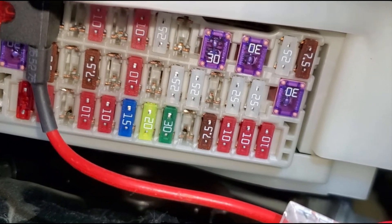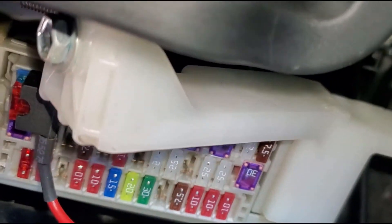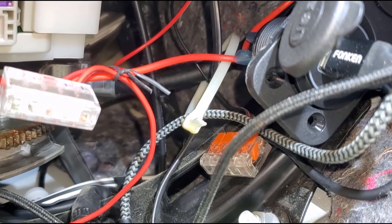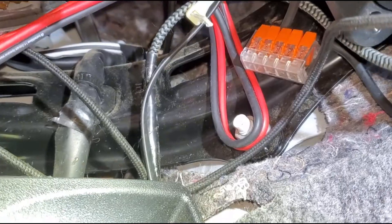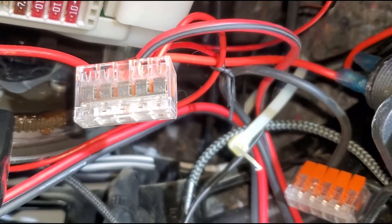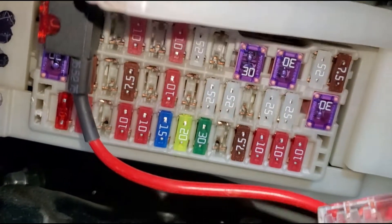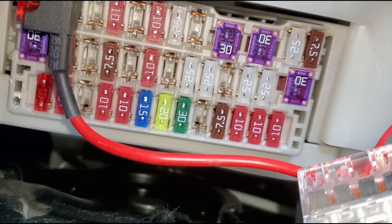There are lots of other places to tap in here if I need more lines, but I don't think I do. I've got one more wire here — I'm going to hardwire my car's four-channel DVR into those blocks. I've got everything tied into this five-block for the hot going into fuse number three.